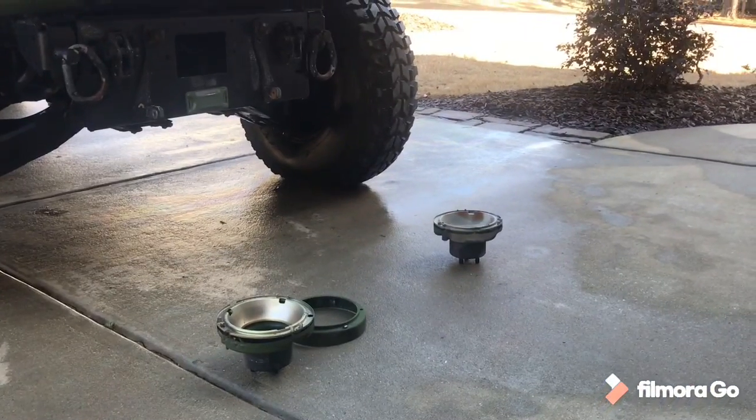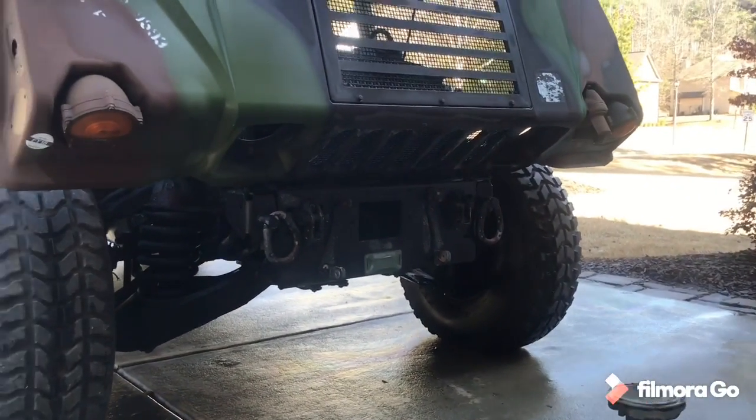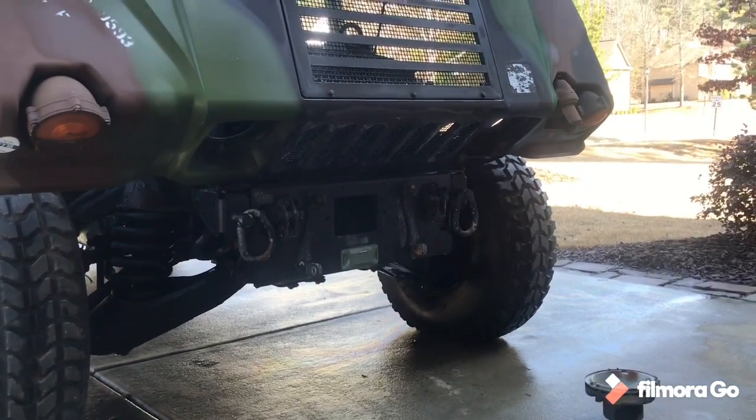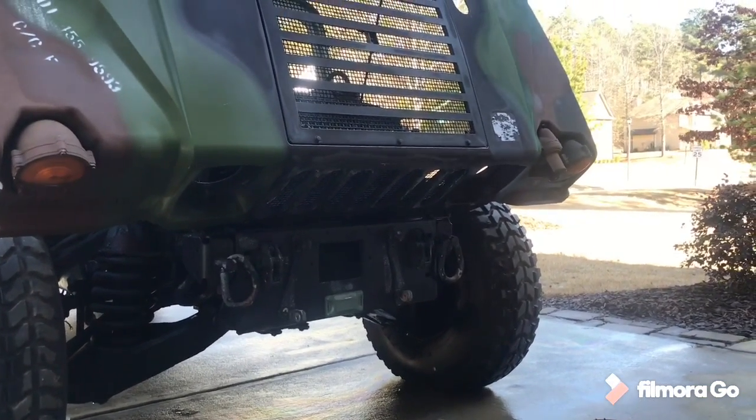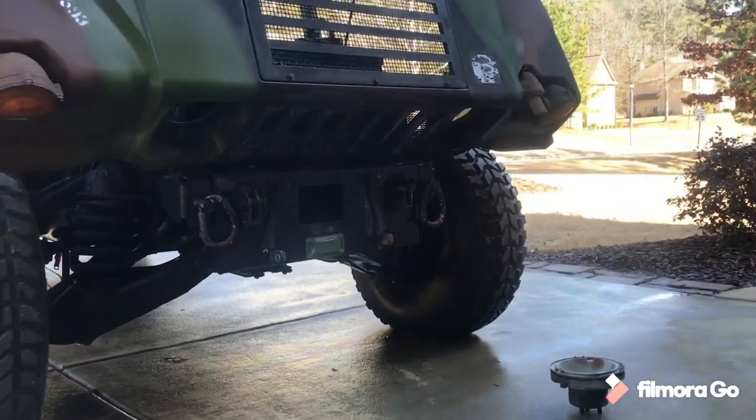Right. Put the headlights out. Just undo the bolt from the back. Kind of got to give outward pressure, like you're pulling them out while you're taking off the nut from behind, so it gives them something to grab onto. So, well, they're out. Let's keep going.